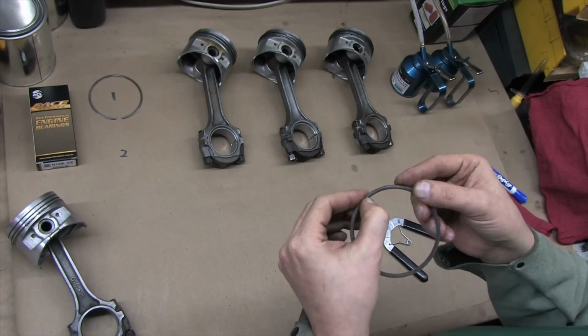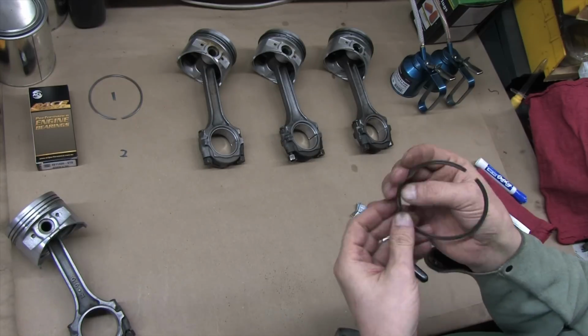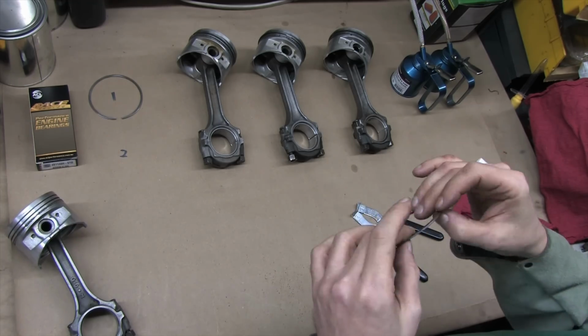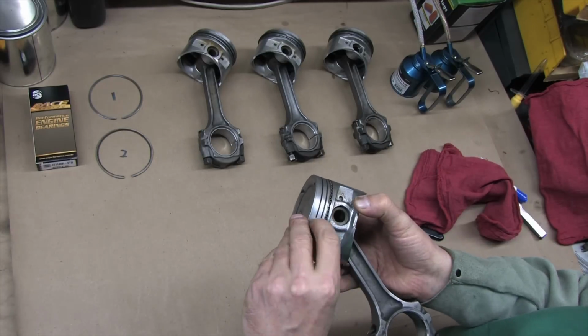In fact, you're supposed to clean the carbon out of the piston grooves before you even do these tests. These pistons came out really clean with just mineral spirits, but I can't take that for granted. It's the principle here. You're supposed to scrape the grooves out, and I'm shooting a video about this. Come on, Jaffer, I told you I'm being sloppy.